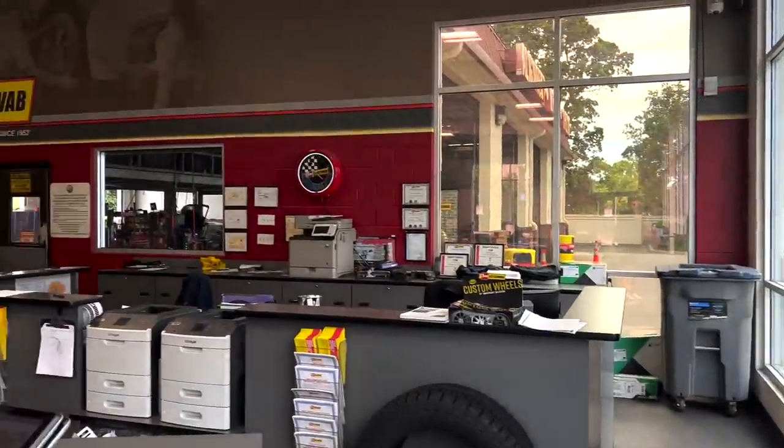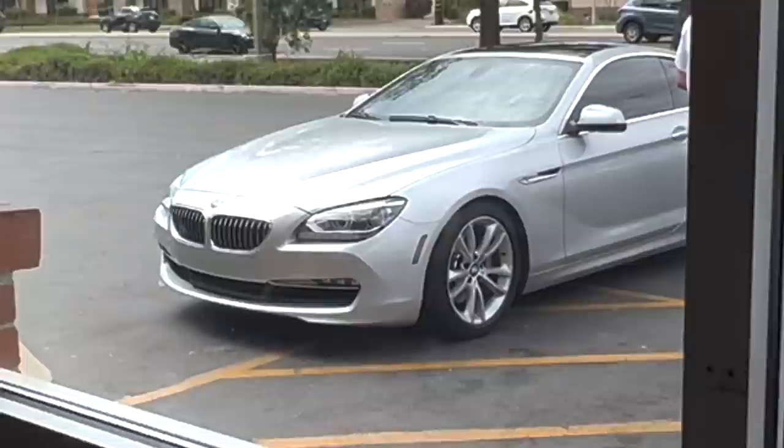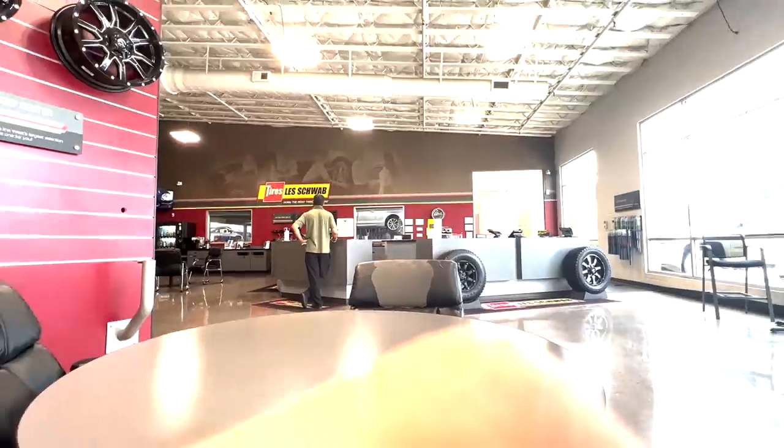While I was doing the test drive, I found out that one of the wheels was kind of shaking. There was some kind of vibration coming from the front driver's side wheel. I took off the wheel, checked the suspension, checked the strut - everything looked pretty much tight. So I took it down to my local tire shop for their free suspension inspection. They found out exactly what it was - a loose sway bar. I just remember now that we loosened up the sway bar to get things out of the way and unfortunately forgot to tighten it back up. All he did was tighten up the two bolts for the sway bar end link and bada bing - no more sounds.